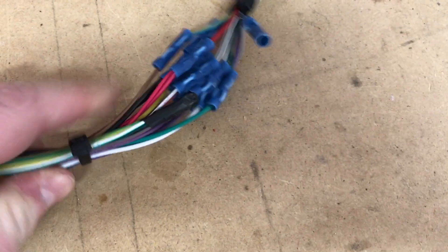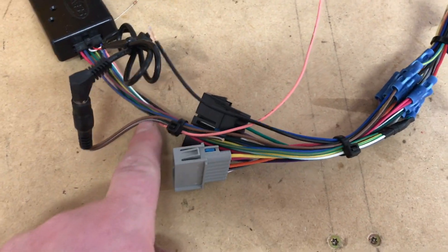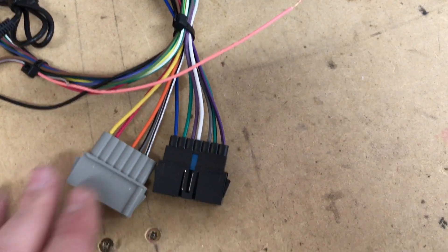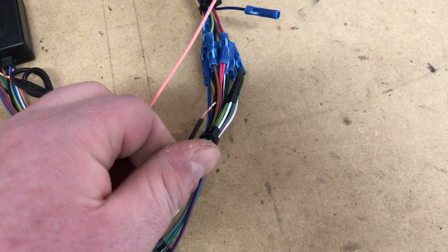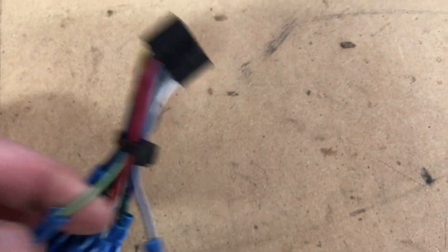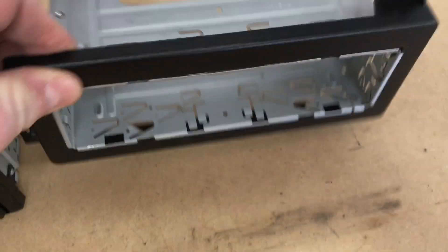Everything else just go ahead and tape off, as you can see here. We're using a Kenwood, so we're going to use the harness it came with, and all we're using is the solid brown wire — not the brown and white striped wire. You may notice in the wiring harness there's no black wire, because the factory radio does not ground through the factory harness — it grounds through a separate wire, so we've kept our ground wire out as well. The metal sleeve that came with our stereo, we've mounted that in there and bent the tabs back so it'll lock in.